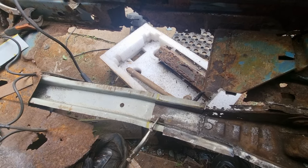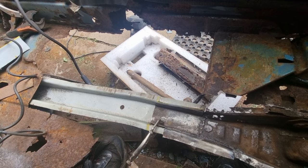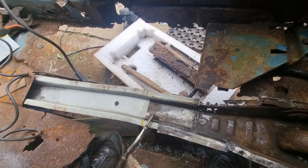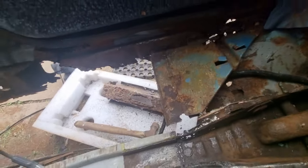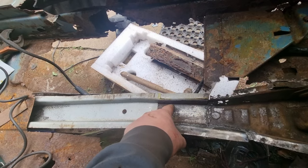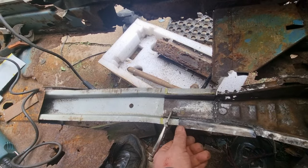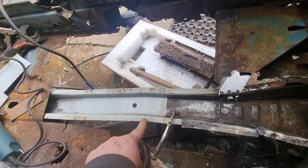Sorry it's not a long video — I just haven't really had that much to do. That's the only update I've got to show you really. This bit here has got to have three spot weld holes drilled there and three up here, and then possibly some in the sides. And then there'll be some across here, some across the lip there, that will then go to this. So hopefully tomorrow I'll have this in permanently.